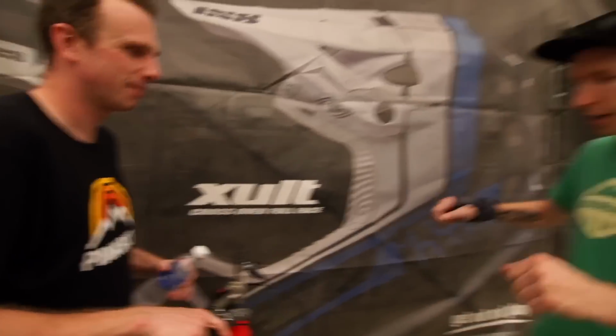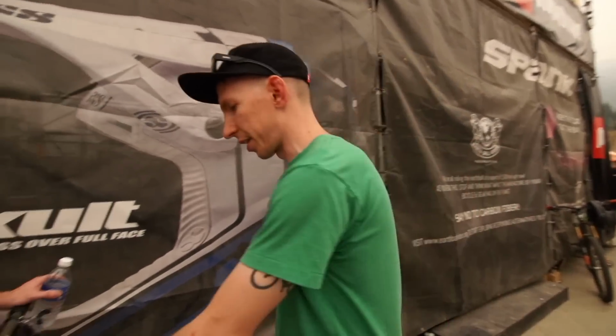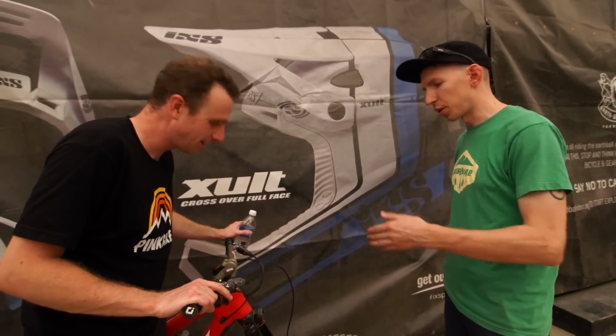If you feel it now, just compress it, you'll see it's not crazy. Oh, okay. Yeah, those are pretty fine tuning things. You can go more. If you just did 1, you're not going to feel anything. Remember, these are your pretty big adjustments. But with those, now you have a total of 8 clicks. You get towards the middle of that low speed compression.